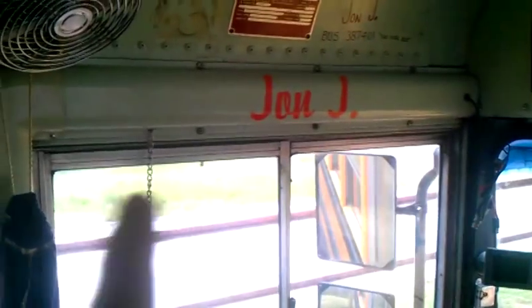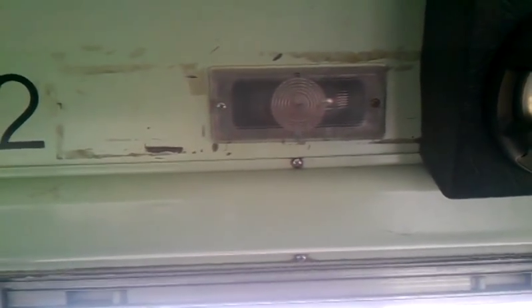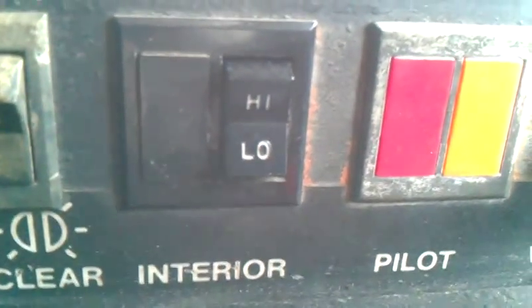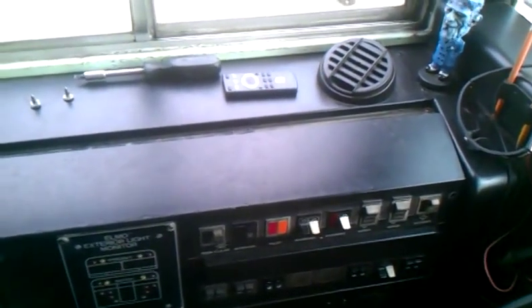Then I ran a connector and scotch-locked with the little suitcase connectors on my supply line going across the windshield and down on both sides. My two supply lines I suitcase connected to the wire, and then each light I suitcase connected a feed wire going to the light from the main wire there. It was nice, it was simple, and it turned out good. As for the lights, I replaced my on-off switch with a heater switch - a high-low switch. The high side is my regular dome lights, and the low side is the dimmer party lights. Anyway, thanks for watching, and good luck with your stereo installs.